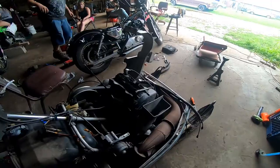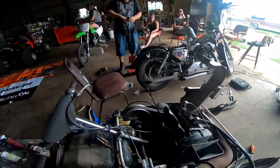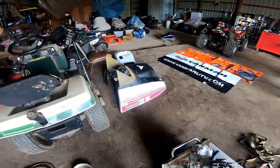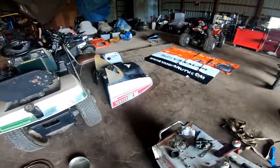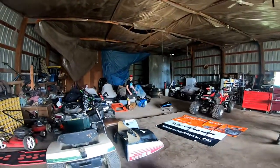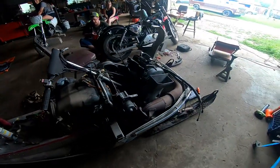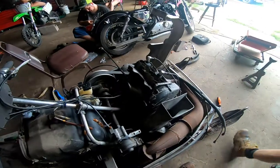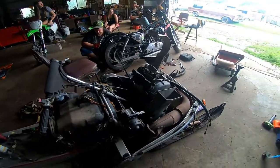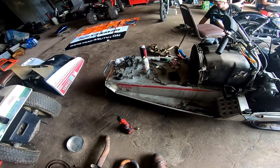It's a bad sign if they get stuck overnight — that tells you the crank bearings are probably junk. Still turns over today, so that's good. There's a good look at the hood in the daylight — it's rough but pretty cool. Last time she was on the old trails was 2004, so that might have been the last time it ran. She's ready to do a trail ride with no seat. They probably parked it in a swamp after 2004. Oil pump's seized, so we're going to run pre-mix — actually we're going to run hot. Regardless, we'll give her a full send.